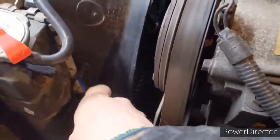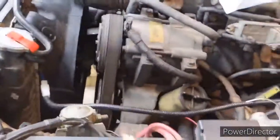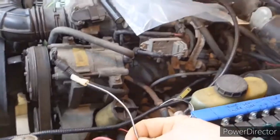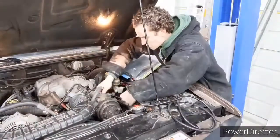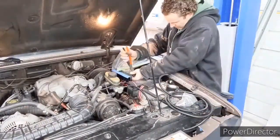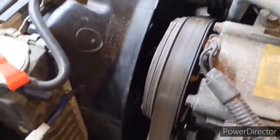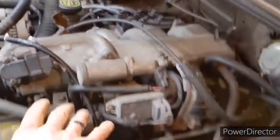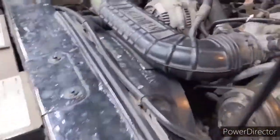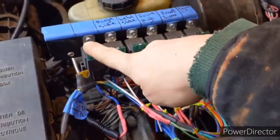You've got the wiring that comes out of the side of the fan. I'm just wrapping it with this corrugated plastic stuff and getting this plugged in to the sensor unit. And as the final look, wiring comes out of the fan, gets covered in all this nice plastic stuff, like everything else should be. Comes around, plugs directly into the temperature sensor here, comes around, comes up into the relay switch.